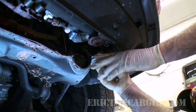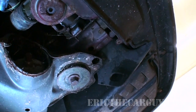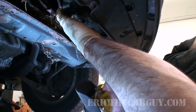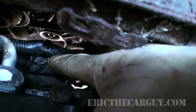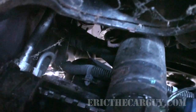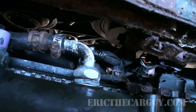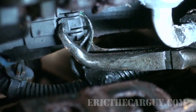I'm going to try to be nice one last time. That's progress. Fans are all disconnected, hoses are loose. I just need to reach up in here and undo a few clips that hold some wiring into place. There's a connector here for one of the fans that needs to be undone, another plastic clip, another connector for the other cooling fan, and yet another plastic connection here. That's really the reason why I have to do it this way, as opposed to the way I normally like to do it, which is just take the fans and everything out as one unit. I use these hose pliers to reach up in here, depress the release, and just pull back.